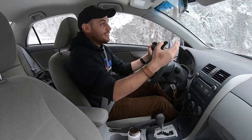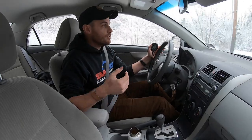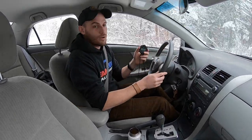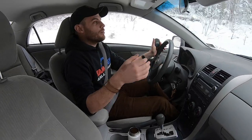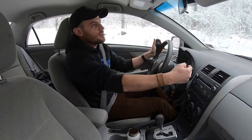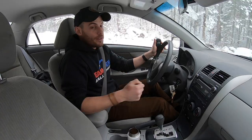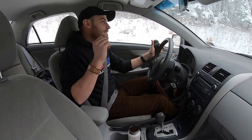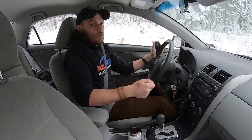Let's give this a shot with the stopwatch and see what we can get for deceleration. Everybody's happy measuring zero to 60, but if you do 60 to zero people lose their minds. If you can get from 60 to zero in a shorter time, that will also be a shorter distance. We're going to do 45 to zero — on a backroad like this, that's pretty relevant. First time: full ABS to a stop. Second time: full ABS with the emergency brake. Third time: threshold braking carefully, maybe just a little bit of ABS. Fourth time: threshold braking with the emergency brake.